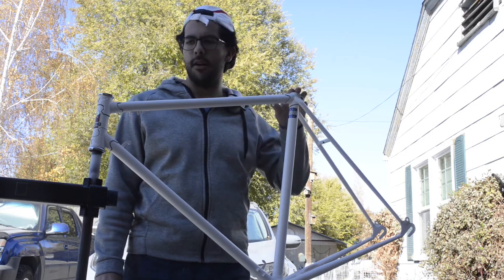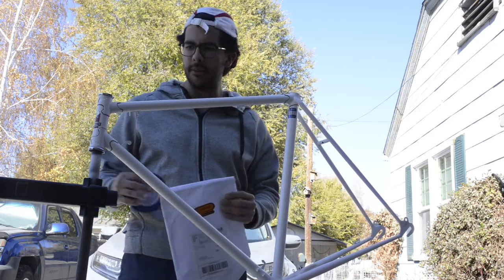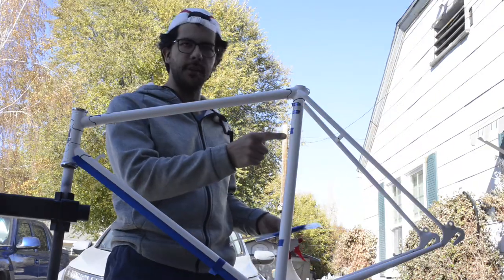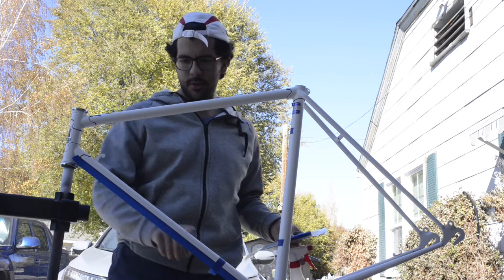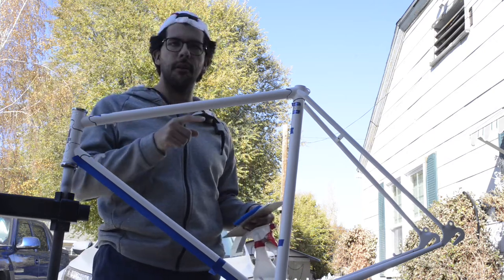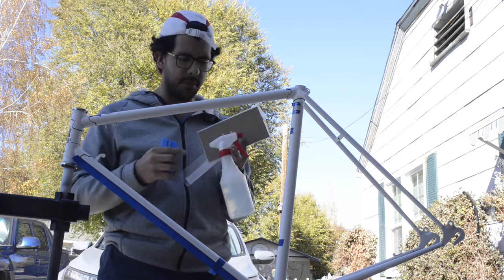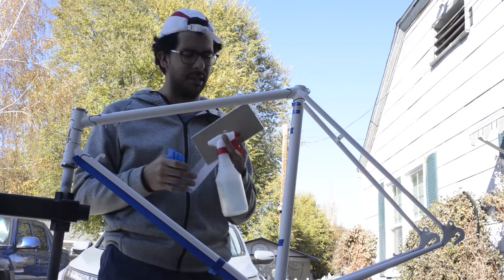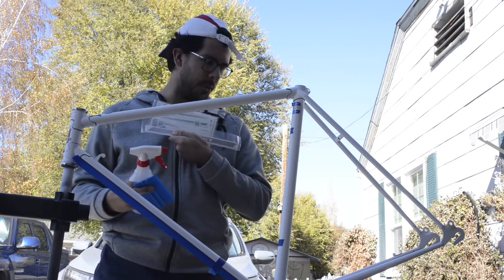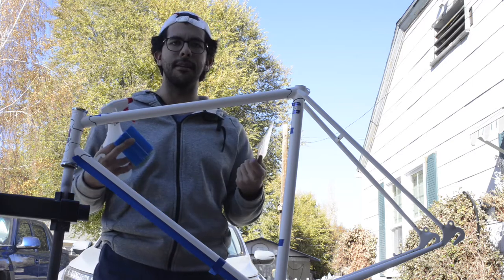So this has been curing now for about 24 hours. I sanded it one last time after the final coat and it's nice and smooth. Now I'm going to go ahead and put the decals. These are vinyl decals — I got them from Velocals. I have the top sticker, the center seat post sticker, the two on the down tube that go on left and right, and the one that goes on the top tube. What you need is a squeegee or any form of card, a spray bottle, three drops of regular dish soap — make sure it doesn't have any oils or lotions — and distilled water, because the water here is really hard. Ideally use distilled water so you don't get any small sediments. So I'm gonna give this a try and see how easy or hard this really is.